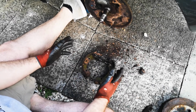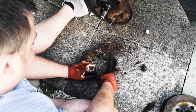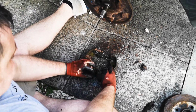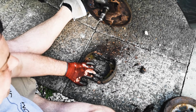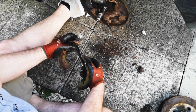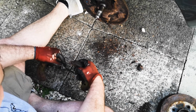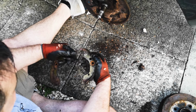So the first thing you want to do, once you've got them on the floor, is release the bottom spring, like so, and then you can put that to the side in the location where it would be going. And then to get the top ones off, simply unclip the side with the handbrake cable and then take the spring off,